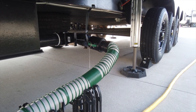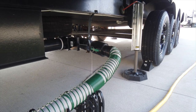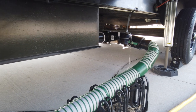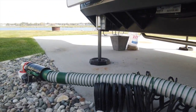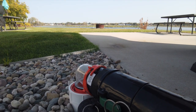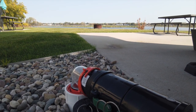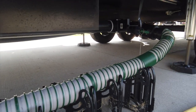We're going to start connecting things up and we want to make sure that we have our gloves on. You want to make sure that your waste lines are connected — connect up to the main dump valve, and if you have a secondary one like we do in the back, make sure that line is connected too. Run the flow in a downward direction so it flows toward the actual waste hole. Connect everything together, make sure it's a nice tight seam, and verify you don't see any leaks with a nice flow in the downward direction away from the valve.